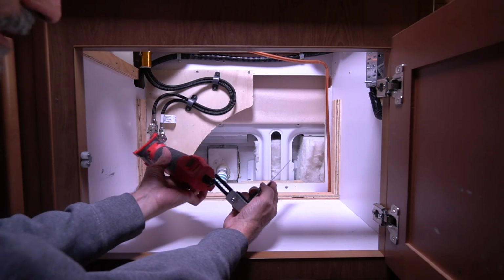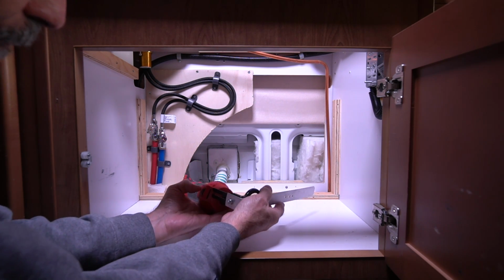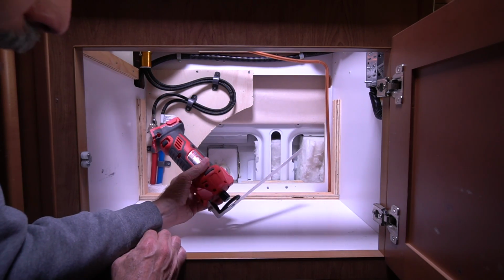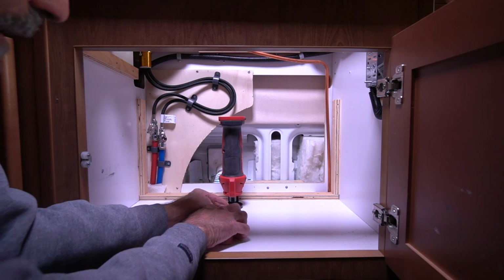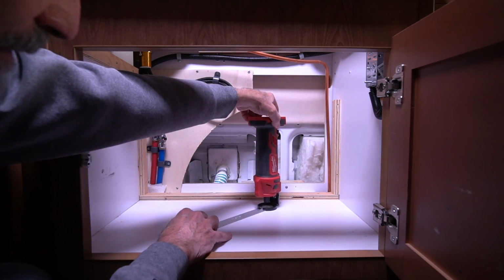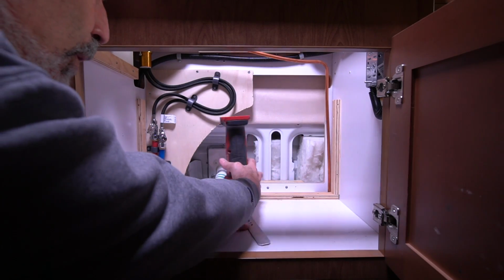And this is really the depth gauge for this tool. I put that little piece of aluminum scrap that I had, I bent it, drilled it out, and I've got 3 different diameter holes here. Now I would screw this in to the center mark of this base, and then I could spin this around and I can cut myself a circular hole in here.